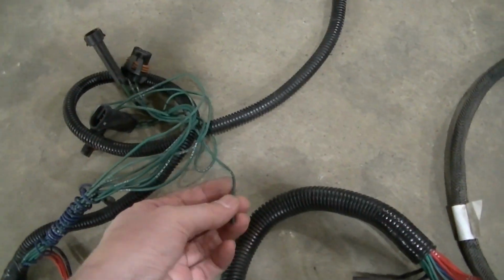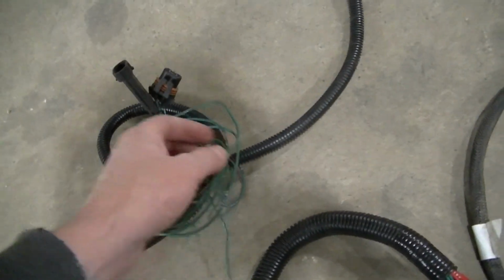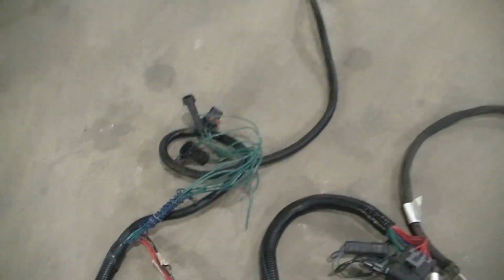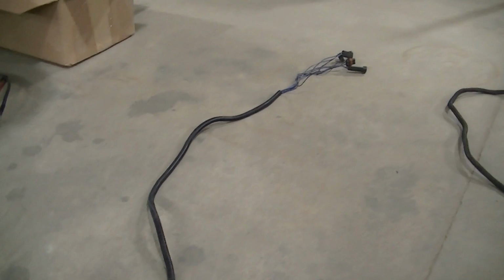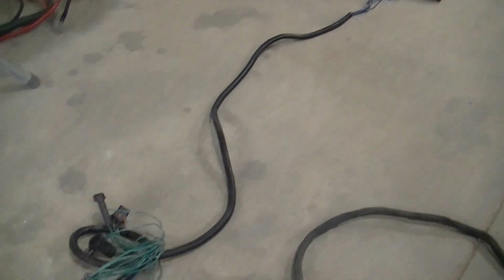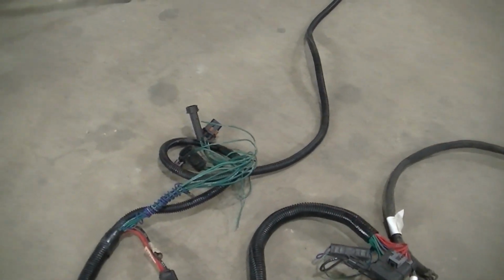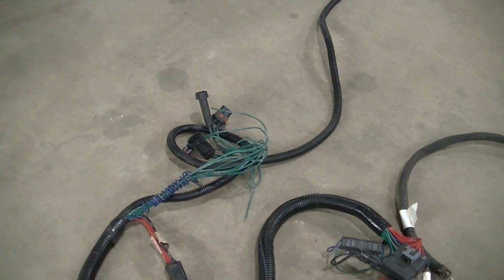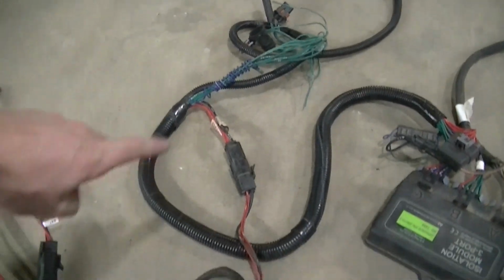And also you've got your parking lights. Well, actually just one parking light wire. And then on each side, you gotta hook up a turn signal wire. You gotta splice into your harness. That's the only wires you actually have to splice into. And I'm surprised that on this new of a truck, they don't have that figured out better, but anyway,